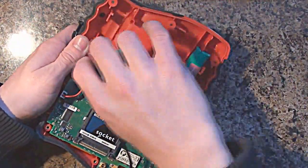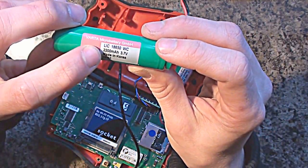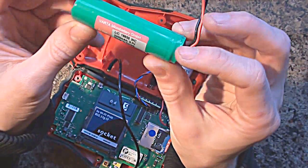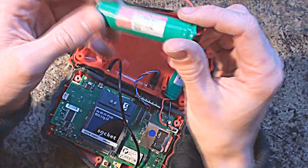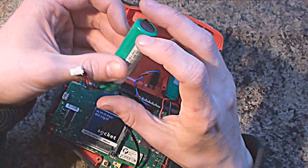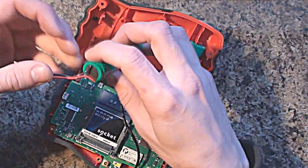In the back here we've got two of these batteries. These are lithium-ion, 2200mAh, 3.7 volts, made in Korea. They look quite well built - a lot better than some batteries I've seen. Usually they're sort of flat-pack batteries, which are in my eyes bloody awful. But these genuinely look pretty good. And the fact they're pluggable means that you could replace them if they wear out at some point - quite a good design feature there.